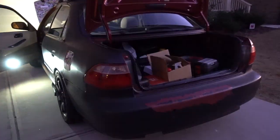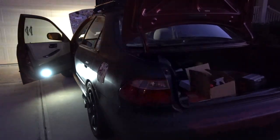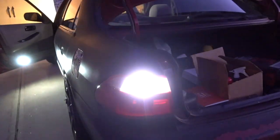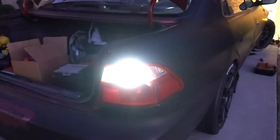I don't know if you guys know but I run white turn signals — probably it's against the law but I'm still doing it anyway. I don't recommend you to do it, but I'm going to put that episode right here. In order to have turn signals this color, I had to open the tail lights. I have a little orange piece inside — every Accord has that — and I had to remove it to run LEDs; they look a lot brighter. I used to run amber but got tired of it and switched to white. If you do this it's up to you because you might get pulled over. But they look awesome.